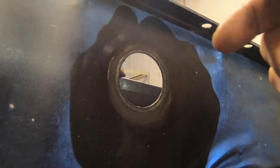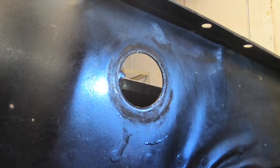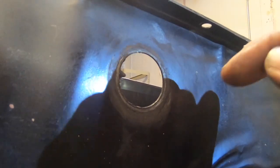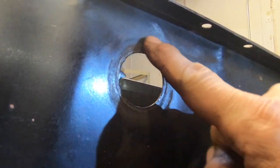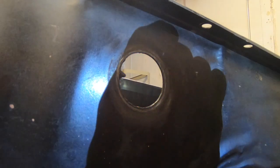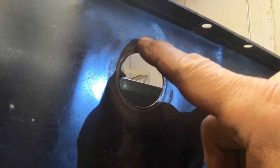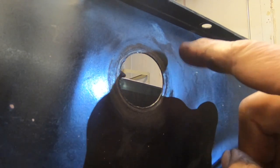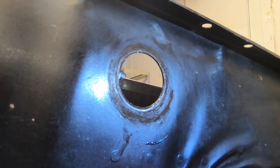As you can see everything is dropped inside the pan, it's now at the bottom — that's a good thing. Once that's done you're gonna want to clean the surface here for the adapter to seal properly. You might have to take a bit of small sandpaper to this, some brake clean. Make sure it's nice and clean and you'll be ready for install after that.